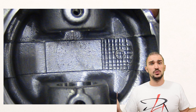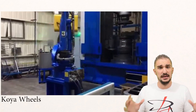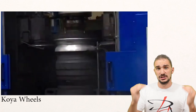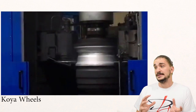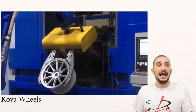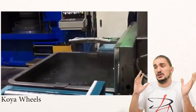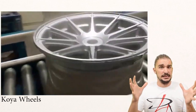What about wheels? There are semi-forged wheels out there too. In the case of wheels, the word semi-forged is partly justified, because a semi-forged wheel is made by using a cast wheel — which is thinner than the final desired dimension — and it's then put into a machine which rolls the inner rim section into the actual final needed measurement of the wheel. There's zero forging going on, but the rim section, which has been rolled, exhibits mechanical properties similar to that of a forged wheel. However, the center section where the spokes are is fully cast — nothing forged — so it essentially has cast properties on the spokes and forged-like properties on the rim section.